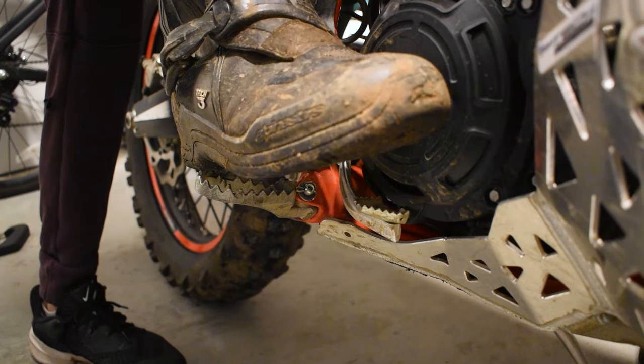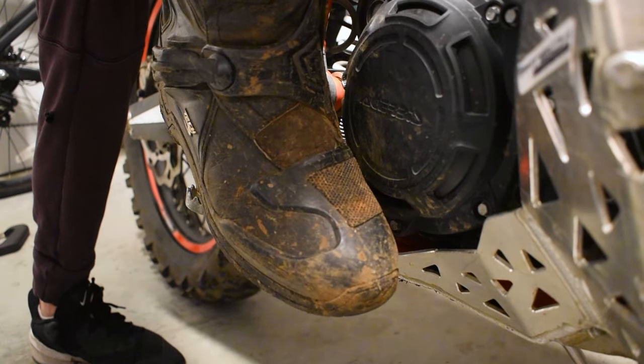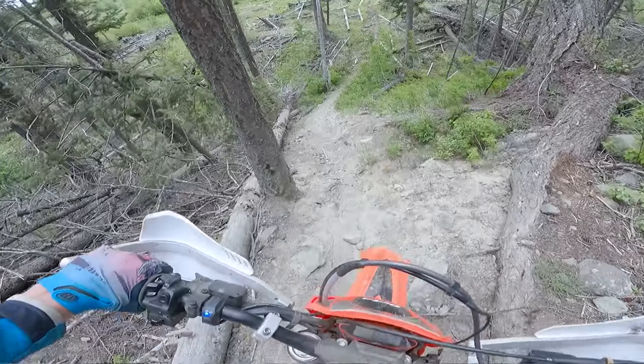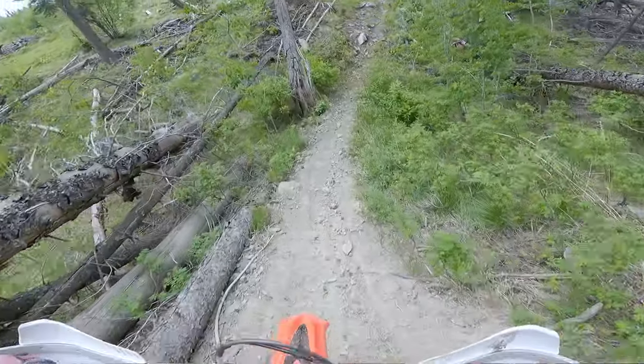My experience with this bike is that the rear brake is kind of lacking — I've got to push it pretty far down to get it to actually bite and lock up, which can be really annoying on long downhill descents when you're trying to drag some rear brake, because your foot has to angle so far down to apply the brake forcefully. Other than that, they do have good stopping power and work great, but they're just no Brembos.